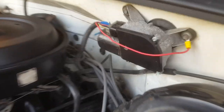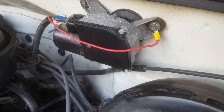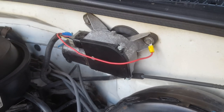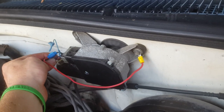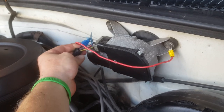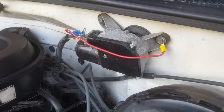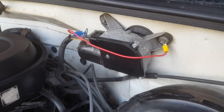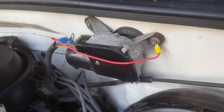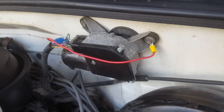The rest of this — I've probably got some wiper motor problems because there's a ground on here that's tied into the wiring to the motor with a scotch lock. Of course, that's not supposed to be there. Apparently the only way the motor is operable is when it's directly grounded, which makes me think that something inside the truck is responsible for grounding that. But I was able to pull up a wiring diagram, so that'll help me tremendously.